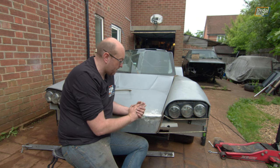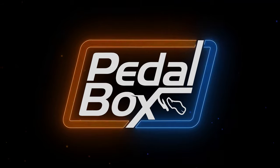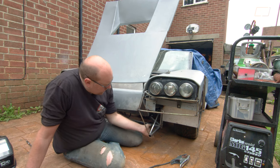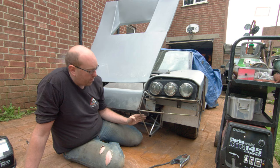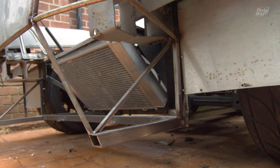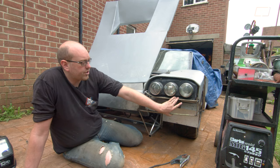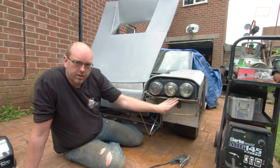Hopefully that's going to work, and once those are done, we'll have a really good idea of what the bumper of this car is actually going to look like. As is so often the way, you start adding a few bits and pieces to work out some geometry, and those pieces end up becoming the solution. What I've done is added a piece of inch box onto the bottom - it's just bolted on at the side - and then a couple of braces that come down from the panel we're trying to support, as well as a cross brace to the inside corner. This is nicely triangulated because it's going to have quite a bit of force from the splitter, which I've also had to start fabricating to get things in the right place and get the holes drilled, and I've added some bracing onto the outside edge of this panel.